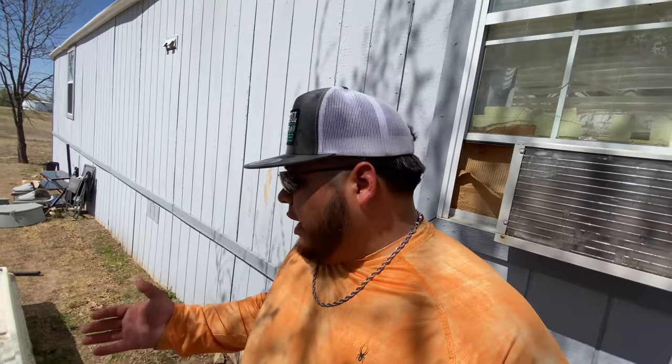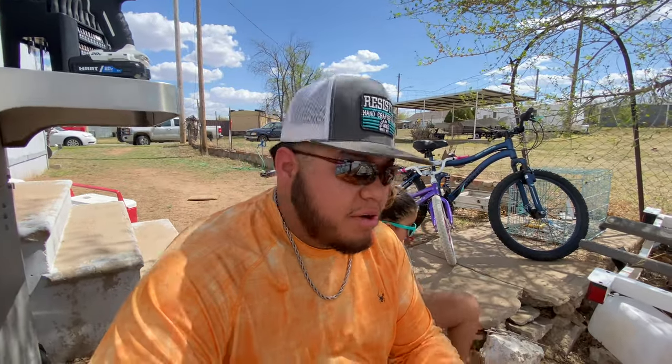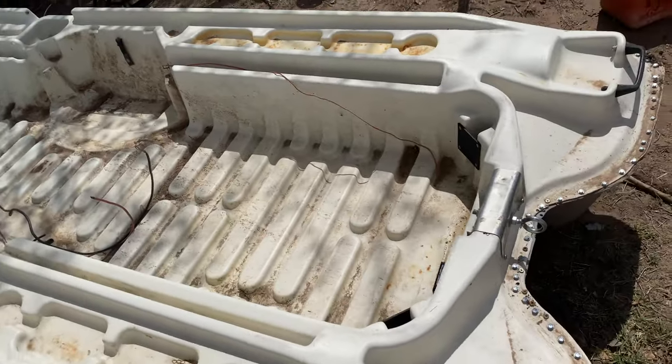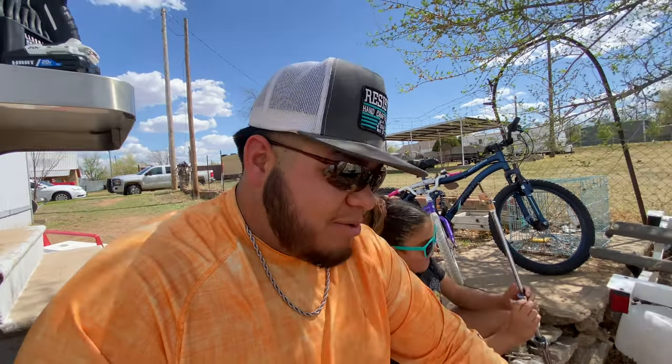First things first: I have already split the boat in half, replaced the wet saturated foam that was making it heavy, and put it back together. I put it back together with tap screws, which was not the best idea at all. The screws did the job but they just stick out — I'd hate for her to get one caught in her hand loading it up. Not only do I want to take the screws off and replace them with rivets, I want to reseal it because the cheap silicone I used is already peeling off.